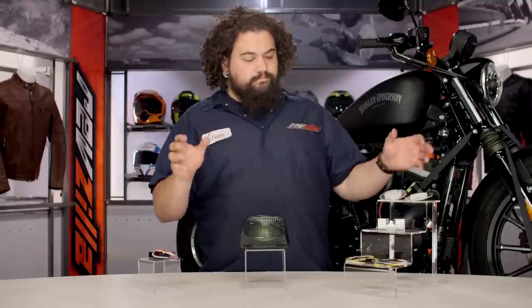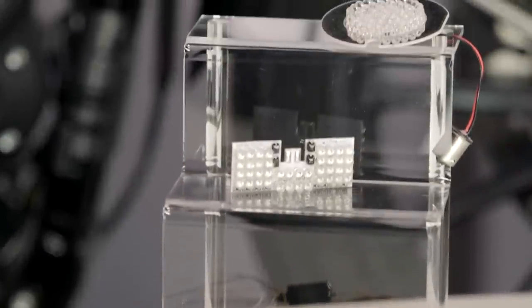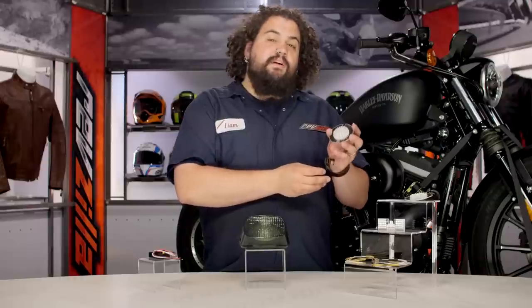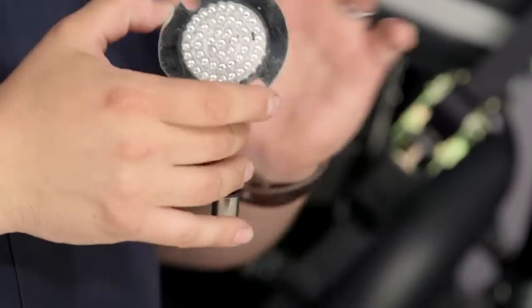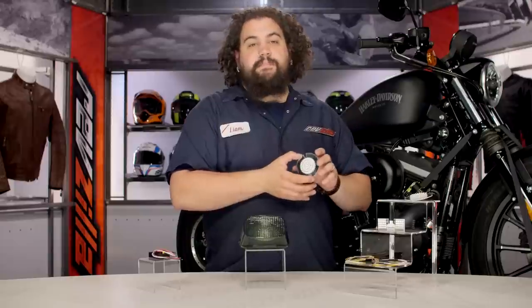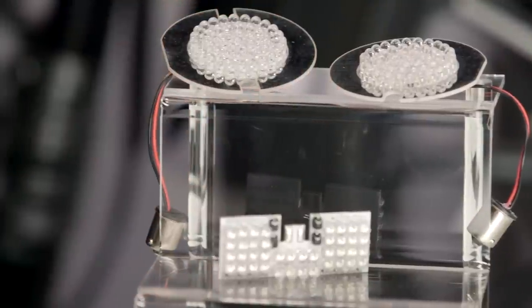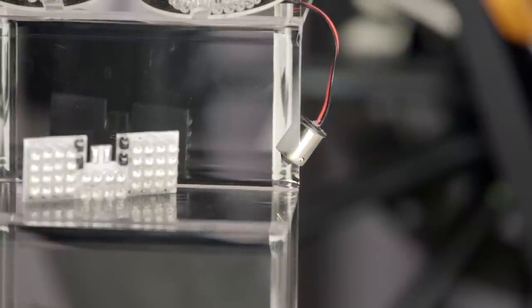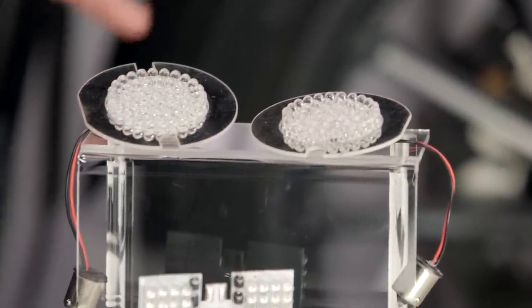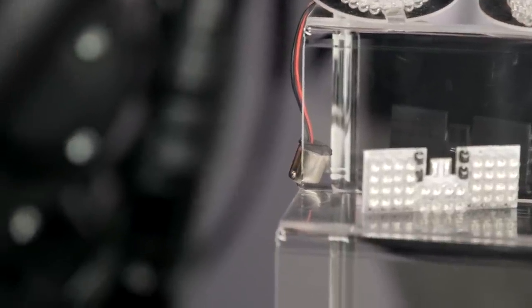These should fit a bunch of Harleys out there. Moving into some of the more specific stuff — here I have a set of LED turn signals, specifically for Harleys. These are fantastic because they fit immediately behind the turn signal lens. They have an 1156-style base and plug right into your factory light housings. You really don't have to do anything more than remove your lens, replace the bulb, and pop the lens back on — and you're going to get super bright LED action from these within a stock housing. When replacing turn signals with LED, the load is different because you're not drawing as much power, which confuses the turn signal flasher. Rather than you having to figure out the resistor value and wire it in, Custom does that all for you. So these are ready to plug in and go — you should be cruising down the road with LED-fired turn signals in just moments.